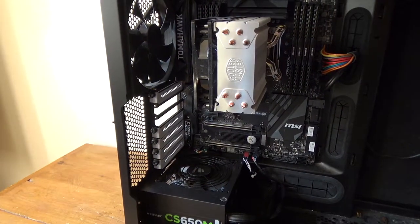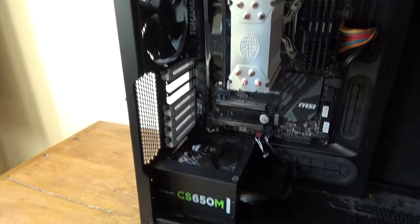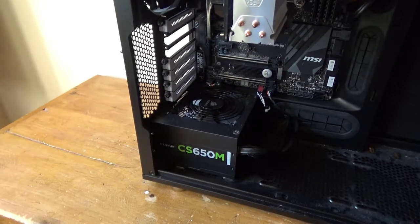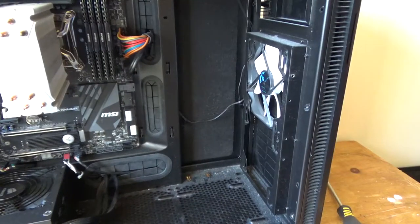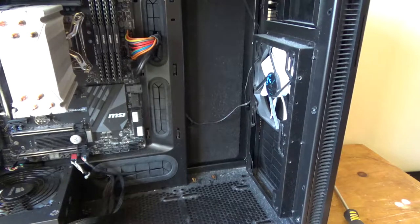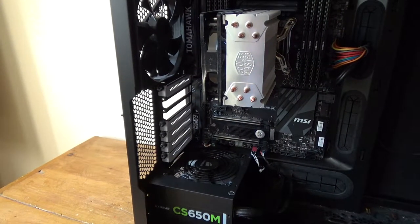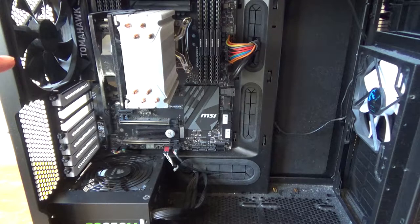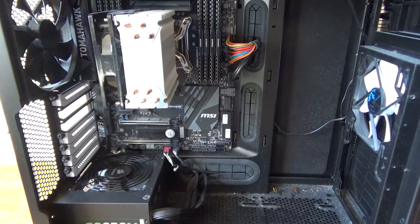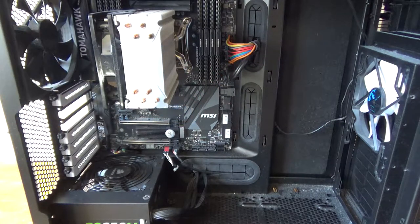At the start of the video I was talking about fans and airflow. I only have one intake fan at the front but I have two exhaust fans - one at the top of the case and the other on my power supply. Originally I had two intake fans and two exhaust fans which balanced the airflow, but I accidentally broke one of my intake fans. I just left the two exhaust fans and never thought twice about it. Because there are more exhaust fans than intake fans, it creates a negative pressure inside the case, so one of the exhaust fans compensates by drawing air through every small crevice in the case.